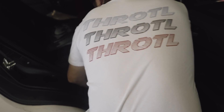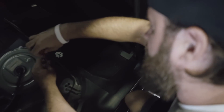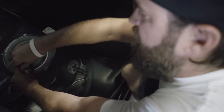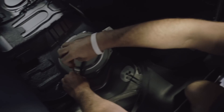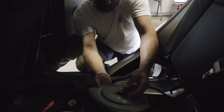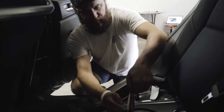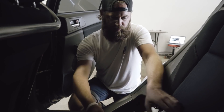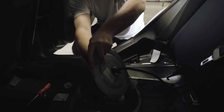There's four of these bolts to pull out. We're not using any power tools just because they create a spark with their motors, and since we're gonna be dealing with fuel, we're gonna do all this with hand tools. Since this panel is pretty big, what I like to do is pop the rubber grommet free and pop it through the hole. That way you can move this out of the way until you get it unplugged, and it'll also make it go back together quickly.